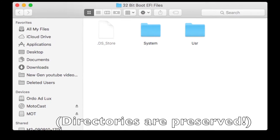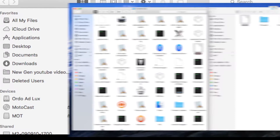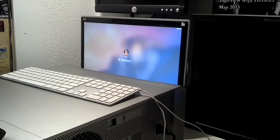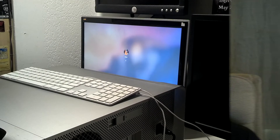Next, you will need the proper boot.efi files, which I have linked in the description below. You must use Carbon Copy Cloner to clone these files to the proper locations to supersede any instances of rootless. Once these files have finished, you may eject your Mac Pro from your desktop and shut it down. Start your Mac Pro back up, hold the Option key, and you should see your identical copy of your supported Mac's installation on your Mac Pro.